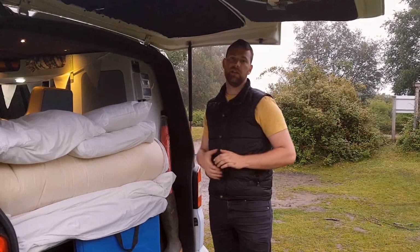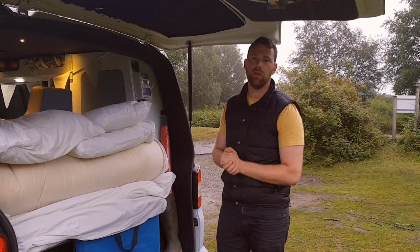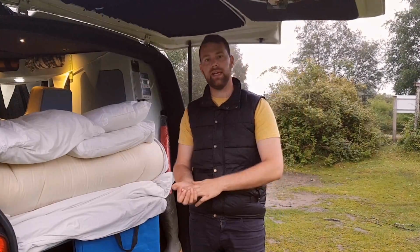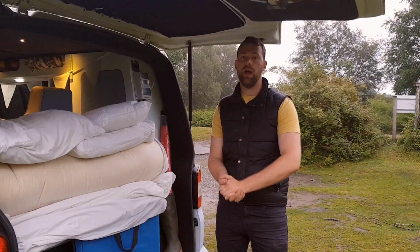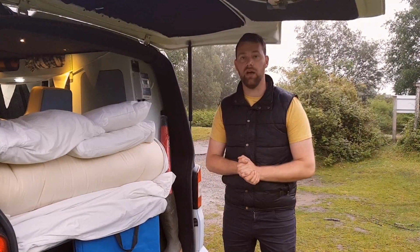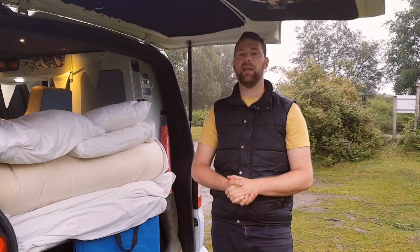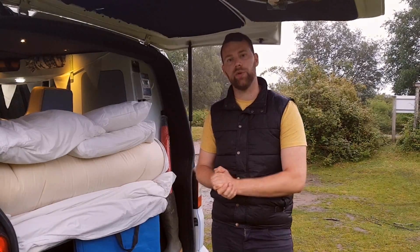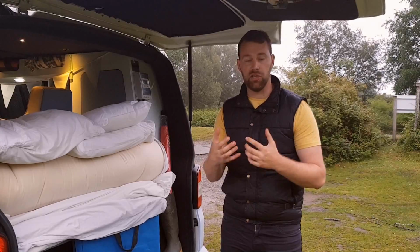This is our solar panel charge controller. Now this is an MPPT one. There are two varieties: a PWM and an MPPT. They're really good systems because they automatically will not just charge your battery to 100%, they will do it free from the sun, and also they will condition your battery. So if you have a split charge relay, like I said before, to do your bulk charge, and then you have this on top, which is trickling into it on those sunny days.